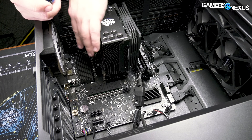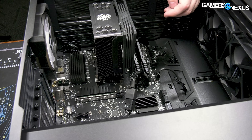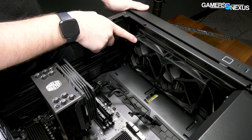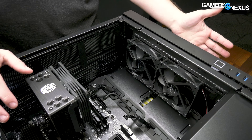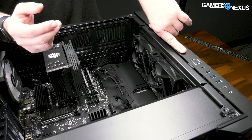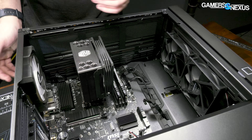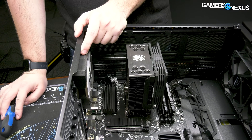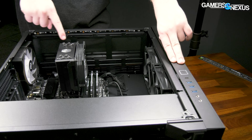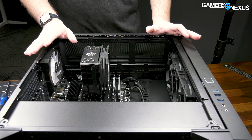I'm seeing some basic heatsinks here on the chipset and on the left side of the VRM, but nothing on the top side. Now that everything's disconnected, there's a quick look around: two 120mm fans up front. The system is completely choked off on the front, with some side intake — but unfortunately only one side is leveraged, so the entire other side of the fan is basically doing nothing. That's pretty unfortunate, and it's not going to help with dust management either because there's no filter in there. One fan in the back — interestingly, this fan is actually going to act less as exhaust and almost more as an additional intake because the front pressure is so poor.